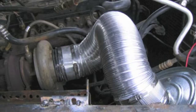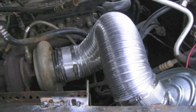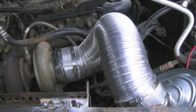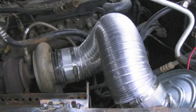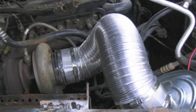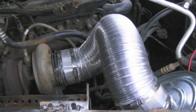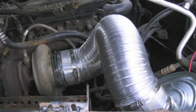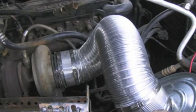Here's a picture of the way it looks when we finally got it hooked up to the turbo. The whole process probably took about an hour. I don't really like the way the tube has a few too many bends in it, and I'm actually thinking about expanding the pipe to a 6 inch and reducing it down to the turbo size later on. But things were tight and this was one of the best ways we could get it in there. Air really does flow into this thing really well from under the truck and from the front, so hopefully that makes up for some of the tube restriction.